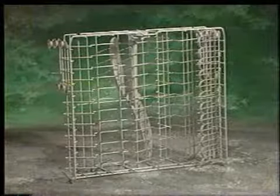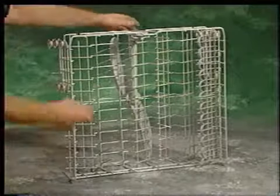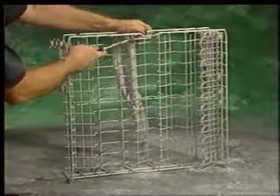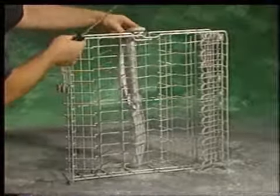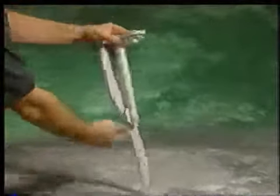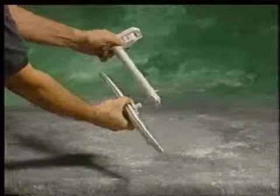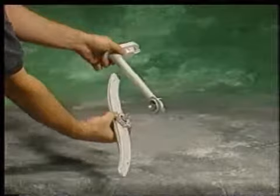Attached to the upper rack is the upper spray arm assembly. The upper spray arm assembly can be removed from the rack by disengaging the rear tension clip. To remove the upper spray arm from the assembly, disengage the arm nut by turning it counterclockwise and then separate the two components.